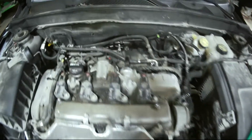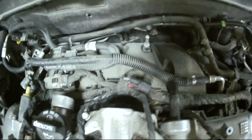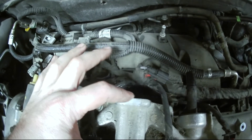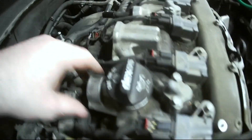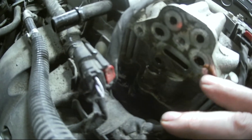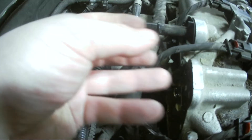After we got that intake hose out of the way, we've got the part right here — it's the oil control valve. We went ahead and took it off and put our actuators back in. Three bolts is all that holds it in, and one plug — just pull your red clip up, pop it off, three bolts, and it slides right out. Then you can bench test it.